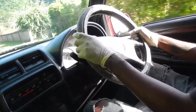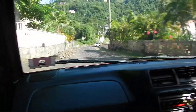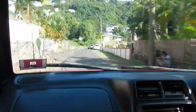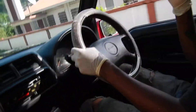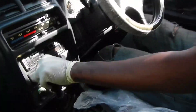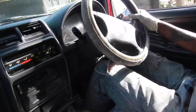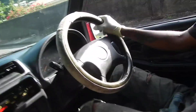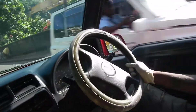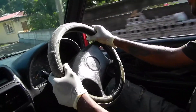When I test drove this before, you could hear the noise — especially when you take a corner. The turn was telling you like that, you'd hear it. Looks like the bearing was the problem. I want to take a left-hand corner. It was predominant on the left-hand turn.